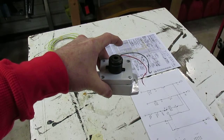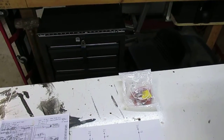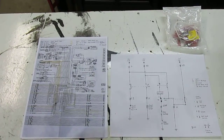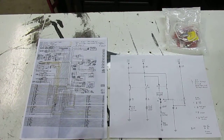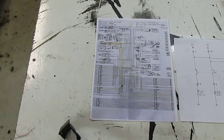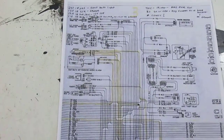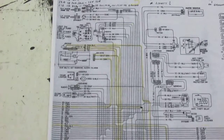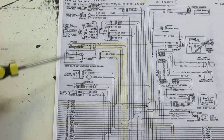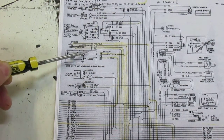Anyway, that's what the thing's going to look like. Now I'm going to go over the schematic that I came up with. I'll show you the factory schematic - like all factory schematics, you really can't tell a whole lot about it because they're so weird. I have some of the circuits highlighted in yellow because I was trying to track down where everything went. This is the actual buzzer right here, and these connections across the top are the ones that connect into the convenience center.